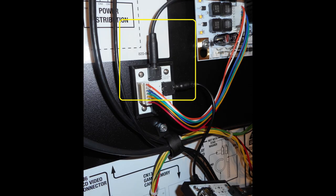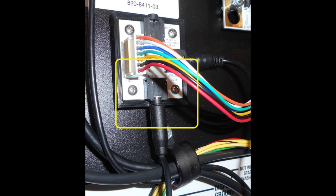If you have a 7 pin CN5 header on your Spike 2 CPU node board, connect the other end of the 1.5 foot audio cable to the sub out jack on the existing Pinwolfer line out board. If you have a 6 pin CN5 header on your Spike 2 CPU node board, connect the other end of the 1.5 foot audio cable to the aux out jack on the existing Pinwolfer line out board.